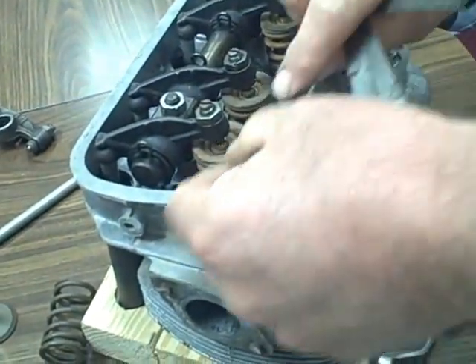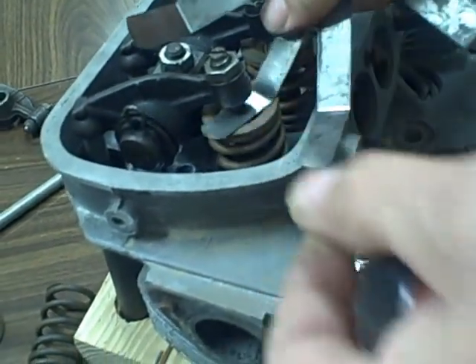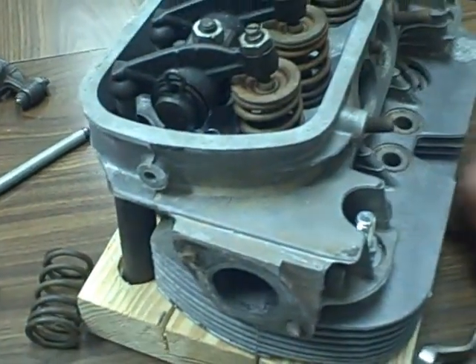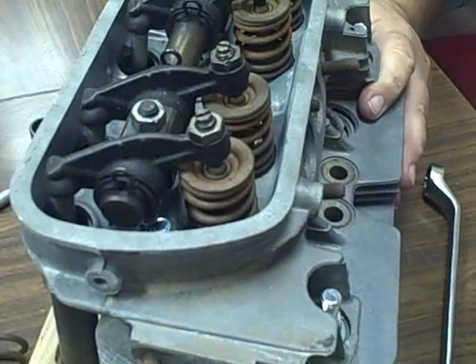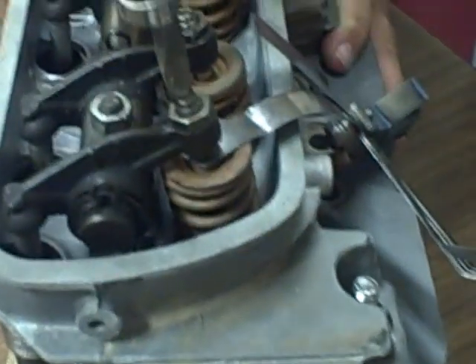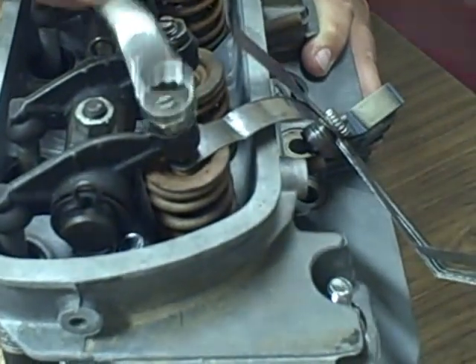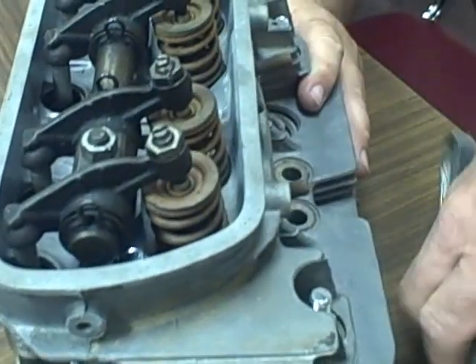The way you check this one being too tight: number five is too tight to go in, and six just barely goes in. So you need to adjust it too. Just loosen it up, stick your number six under it with your fingers, roll it down until it touches, then lock it with your finger so the tappet doesn't move. Just hold it, don't turn it, and lock it down. You got a good feel right there. That's the way you do it.